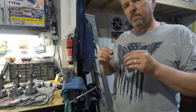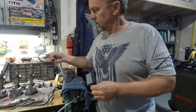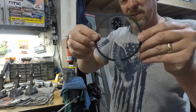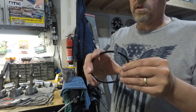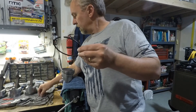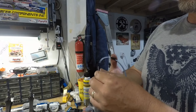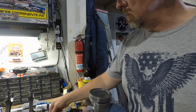It's time to ring our pistons. Did we just get all these rings out of the box and slap them in and hope they fit? Nope. Each and every one of these, especially the compression rings — each cylinder got its own rings gapped, and then you keep track of them and put them with the piston that's going to be going in there, because each bore was done with the piston. That's the correct way to do it. The top ring and the second compression ring — just go by the box. There are all different kinds of ways to mark your first and second ring. These were all gapped in the cylinders, they were all within spec. Oil rails. Oil expander.